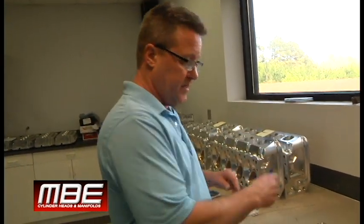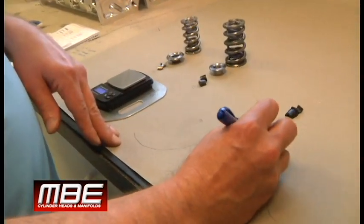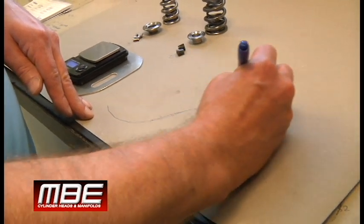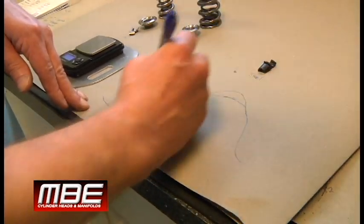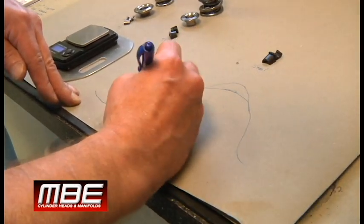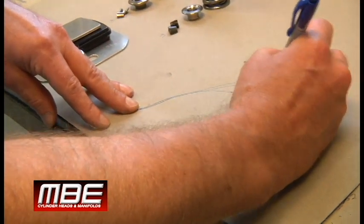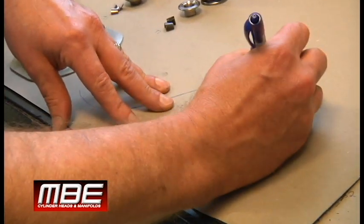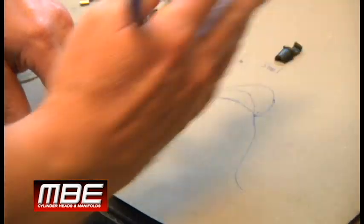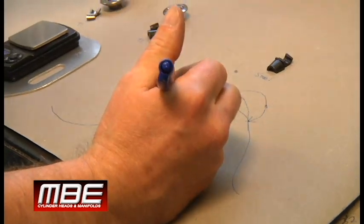When I mean loft, that's the lifter going over the nose. There's never a perfect landing over the nose when the lifter comes up. If it's perfect, you land it here like this. But when you add that weight, it creates loft — and then you have more loft. The problem is this is turning, it creates pressure angle. Instead of landing at the right angle, it lands like this, then the lifter goes up like this. All the harmonics go up through the push rod, which ruins the spring.